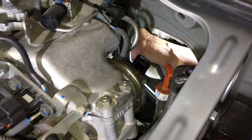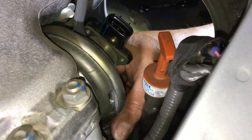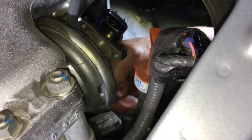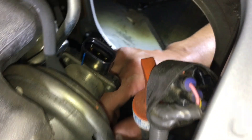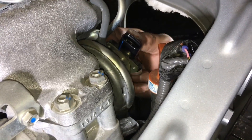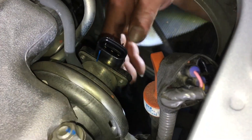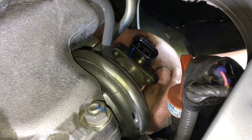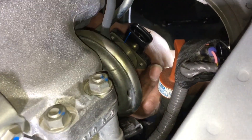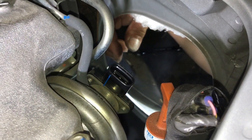Now we've got the rear panel off. At the back here there's a plug that we can get access to — would have been really hard from the front. Much better from there. You can also access your oil filter right here, a lot easier. And also the plug for the EGR up here, vacuum lines on the back of the EGR valve, and the bolt at the back of the EGR valve we're trying to get to. Definitely need to be able to access that plate. AutoSafe needs to lift their game.